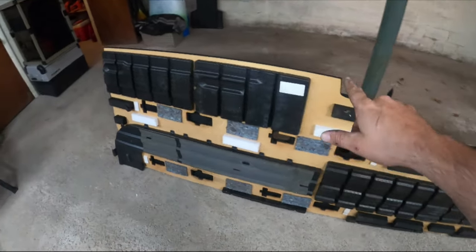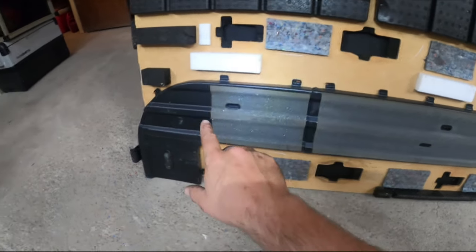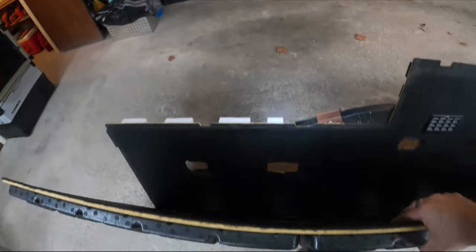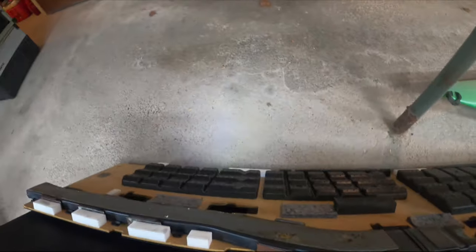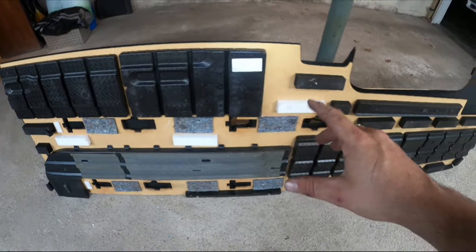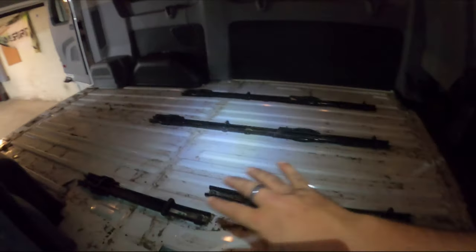You're probably wondering what all this is. Look at the curve — there's a wheel well. This is the floor. In the passenger versions of the Transit, what they do is they have these air plenums that run back from the passenger front seat, and they correlate to these vents right here. So basically, this is just way too thick, especially when it's not really doing any insulation — it's mostly just making an air gap for the air plenum.